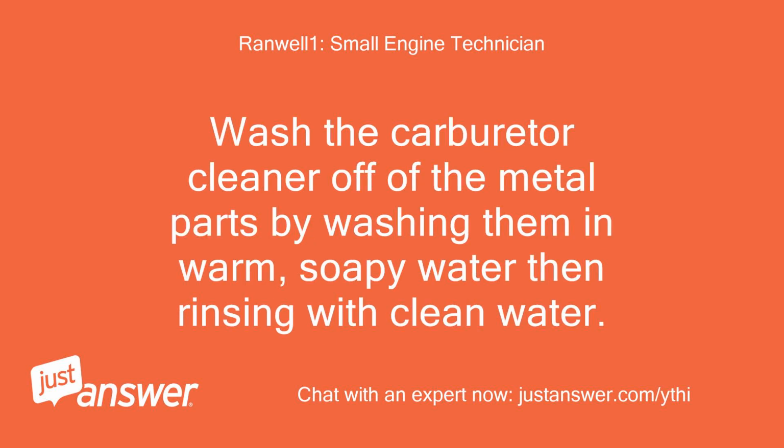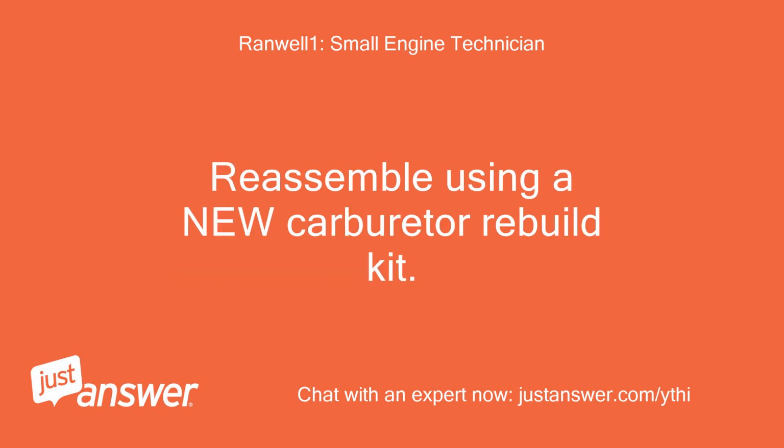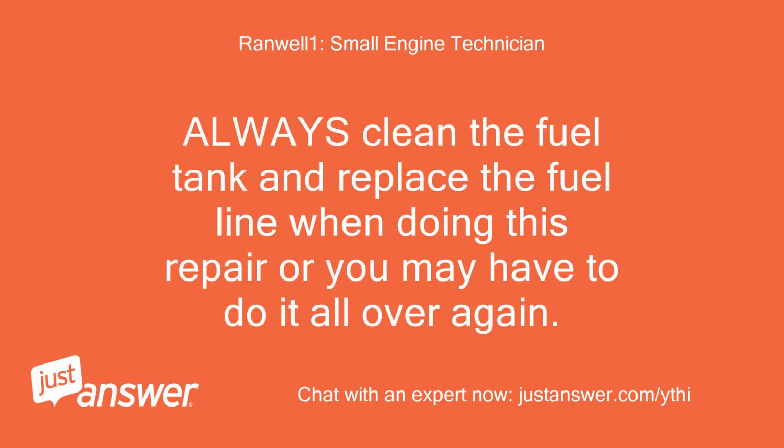Wash the carburetor cleaner off of the metal parts by washing them in warm, soapy water, then rinsing with clean water. Dry them by blowing them off with compressed air. Make sure that all the passageways are blown dry before reassembling. Reassemble using a new carburetor rebuild kit. Do not try to reassemble without using a complete carburetor repair kit. You will just end up having to do the job again. Always clean the fuel tank and replace the fuel line when doing this repair, or you may have to do it all over again.